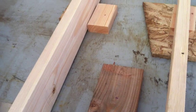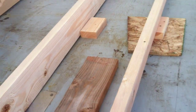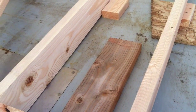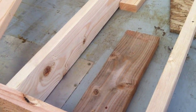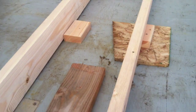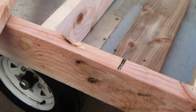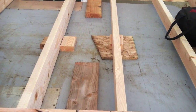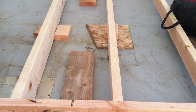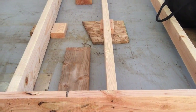The value of the trailer versus the value of the decking — and the frequency with which I expect to replace the decking throughout the life of the trailer — that's no big deal. The spacer blocks keep it from sliding around; they're screwed down, not nailed. When I add a couple of sideways screws it's relatively secure. I don't do that until I put the sheathing on and make sure that the corners on the sheathing are going to make this thing square.